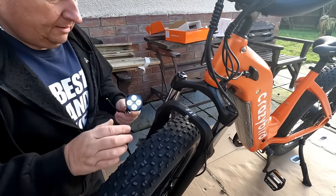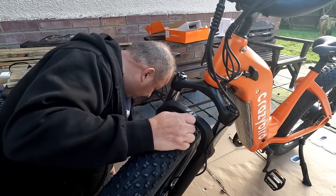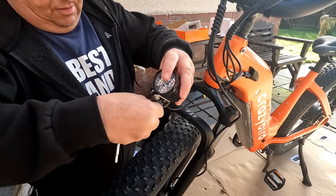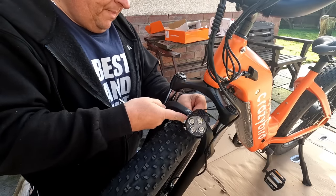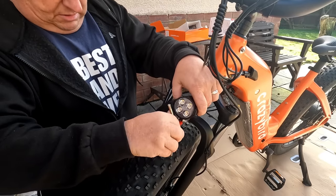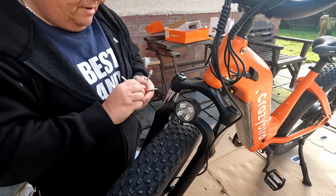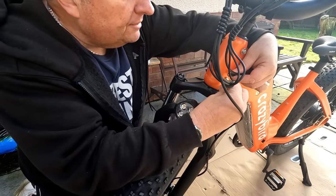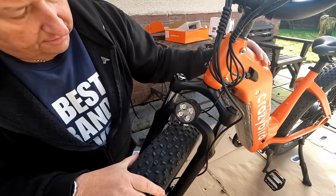Headlight installing time. This goes on here facing forwards. You've got the bolt and nut already in there — it is a nylock nut so you will need to hold back with the spanner. This goes on the front way through there. Just replace your nut and washer on the back, holding your spanner on there so it doesn't spin, and just tighten up your front nut holding it in the top position. And you should find the connector for that, which lives up here — a yellow connector. It can only go one way. Locate the pins, and there you go. It's as simple as that.